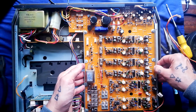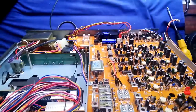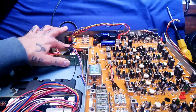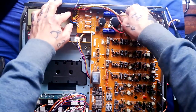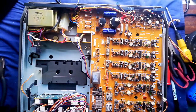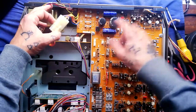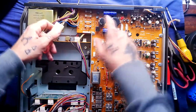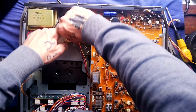As mentioned earlier in the series, we really have to take this amp PCB out completely to do cleaning of the mixer, because the mixer is underneath here. If I tip it, you can see three voltage regulators — or some sort of transistors dissipating a lot of heat — with the heat sink part mounted to the metal plate at the back. It's better to unplug them at this end and leave that in situ, because there's often heat compound, like you'd use between a CPU and its heat sink, that I don't want to disturb. This big plug joins the filtration and rectification section of this board to the transformer. Since it hasn't been on for a couple of days, I'm not going to worry about discharging capacitors.